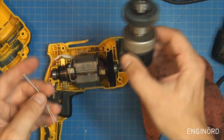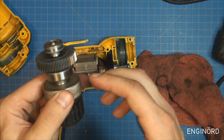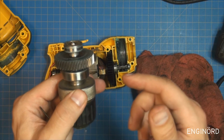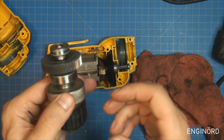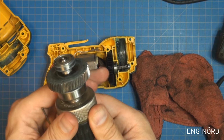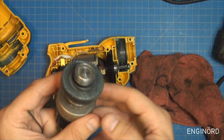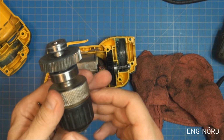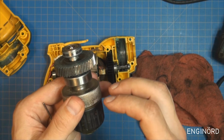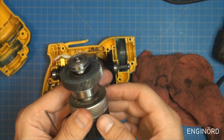Now the powder metal on the other side, you can have, let's say, 540 yield and then a 560 ultimate tensile strength. So they are pretty close to each other. And so what happens is, because of that, the powder metal parts will behave like glass. Okay, so they will just abruptly fail. And I think that's what happened here.